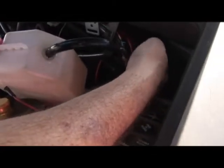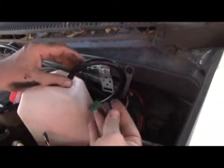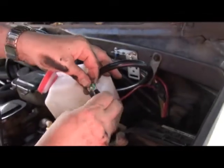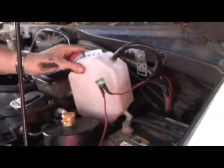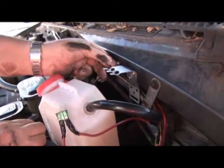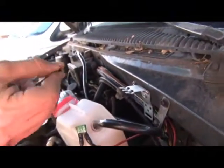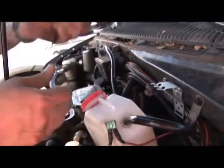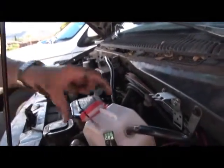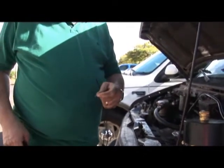As you can see, we're using a tap — I'll show you that in another video. From there it hooks up to a fuse where we make a homemade inline fuse. You just connect it like so. To set up a ground, we simply connect a wire using a self-tapping screw drilled right into the frame. The wire has about a quarter inch of stripping, and we put a connector on the other end as well. Basically we're using 12 or 14 gauge wire to do the install.